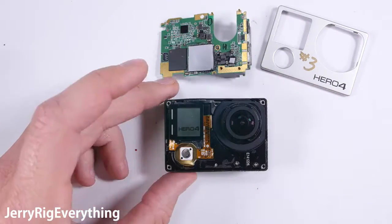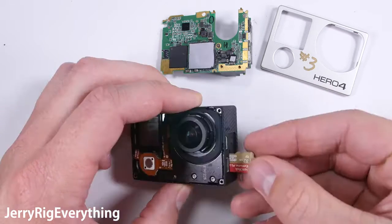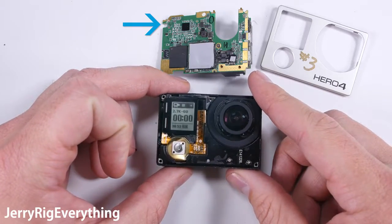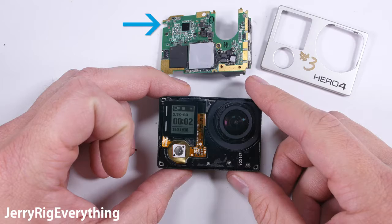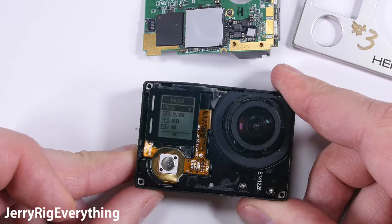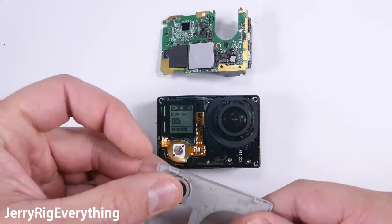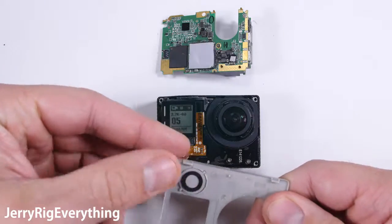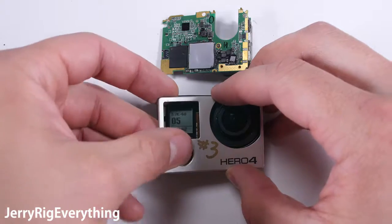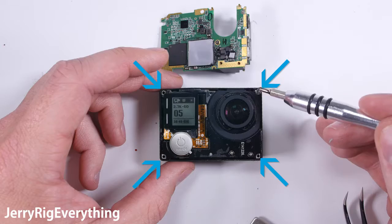Turn the GoPro on — and it looks like the shutter button is reacting. I'm going to put an SD card into the side and double check. And it looks like that solved our problem. That broken connector on the old motherboard was the issue — it was not receiving signal from the top and side buttons. But now that we've swapped the motherboard from GoPro number 7 into the GoPro number 3 housing, everything is working. GoPro number 7 had problems with the power transfer from the battery to the motherboard, but that was part of the housing, so now we have a working GoPro. It's worth it.